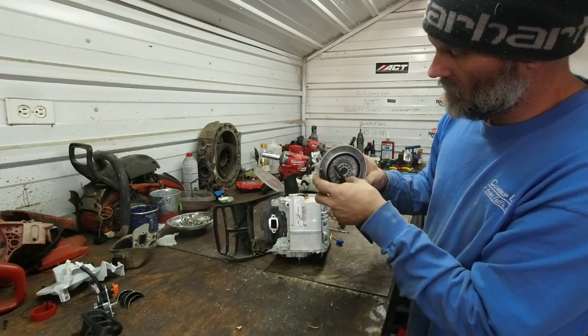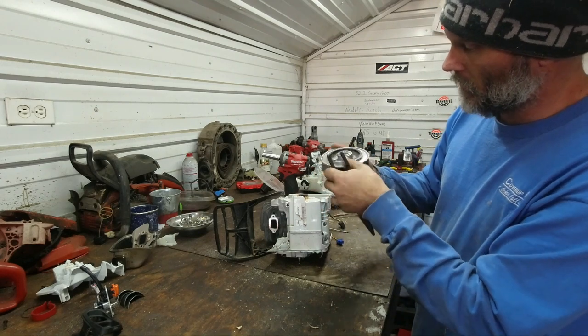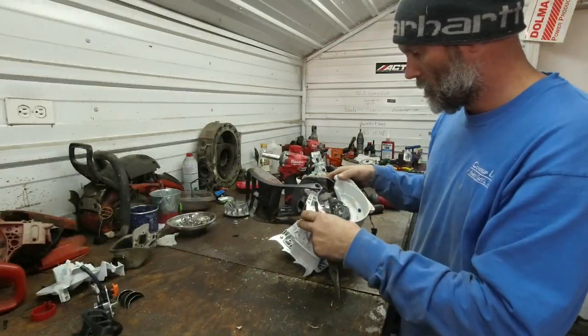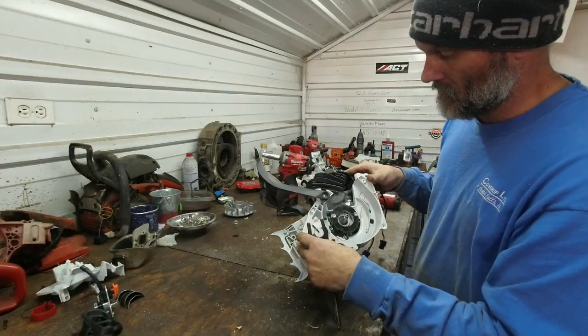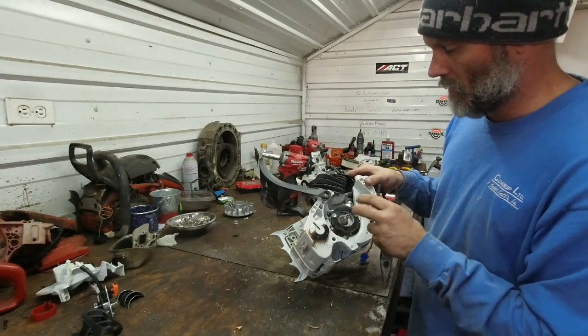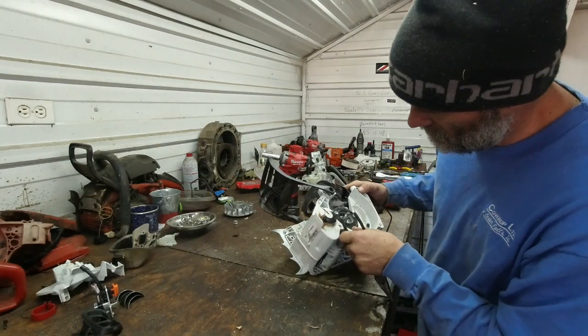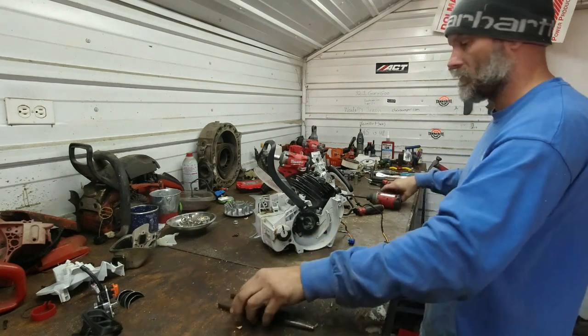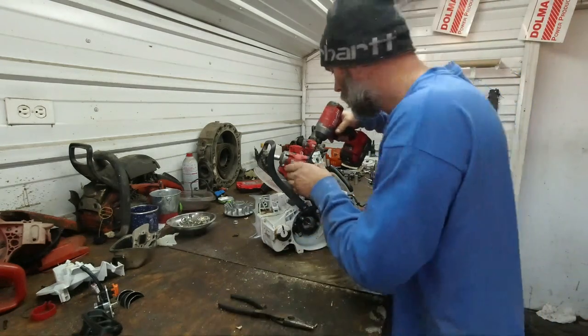I'm seeing no obvious indication of where it would trigger off of. But for the ignition, there has to be a crank position sensor, being as there's not a coil mounted on it specifically. So somehow electronically it knows where the top dead center is.